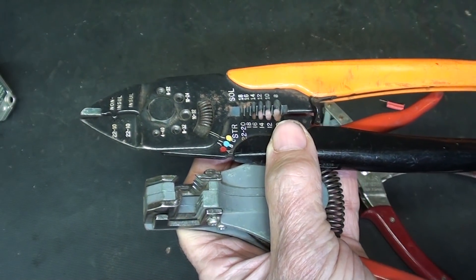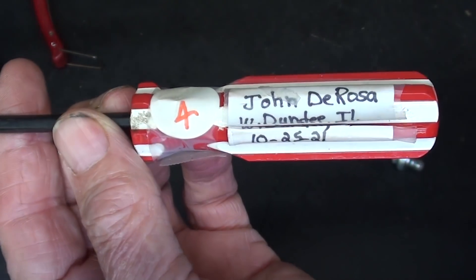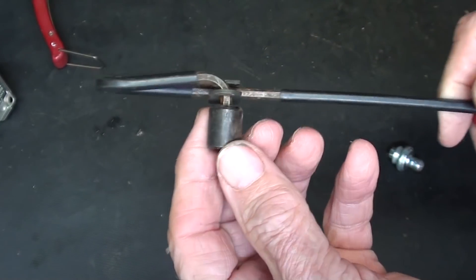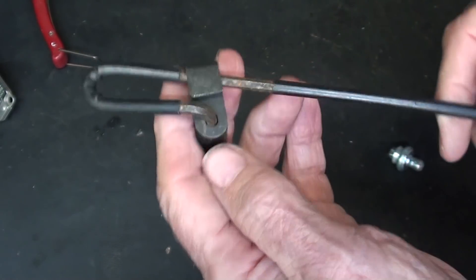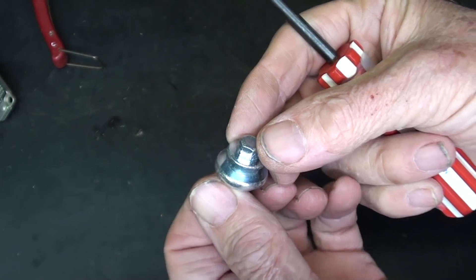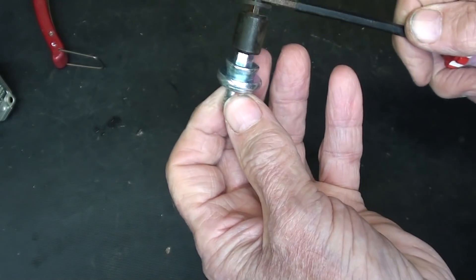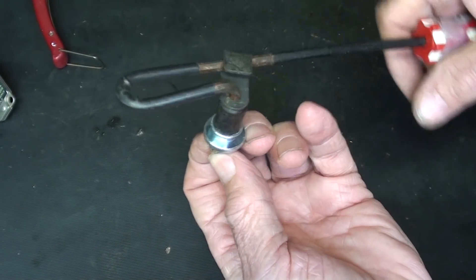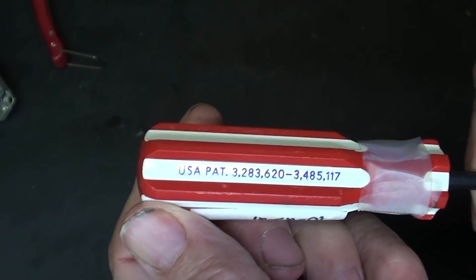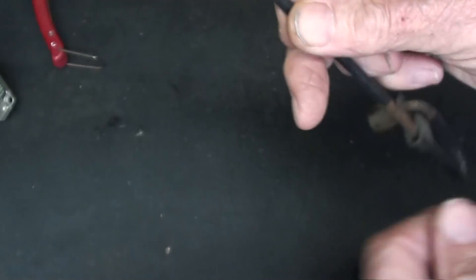On to number four. Item four, from John DeRosa — thanks, John — is a tiny little torque wrench, is all it is. Now I do remember what this was for from hanging around the auto shop teacher at the high school. It is very specific: it is for tightening battery terminals on the old side-terminal car batteries, which would be very easy to strip out the lead fitting if you tightened it too tight. I believe it's a KD tool. There is a patent number here — two patents — made in USA, but there's no label underneath.